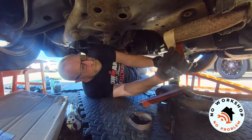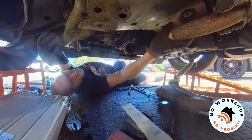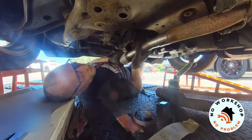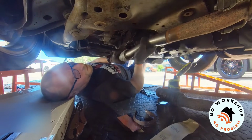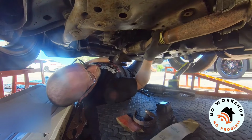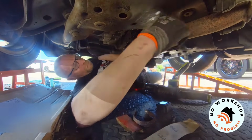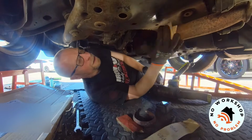Now I suppose at this point naively I thought it would be as simple as cleaning up the end of the old exhaust pipe and slipping the repair section over. Got to say, cleaning up that old pipe took longer than I expected, as you can see here through the various time lapses. The corrosion was well established, and the new part gave me a little bit of a challenge in that the expanded end that should just slip over that old pipe really wasn't expanded as much as it needed to be. And that resulted in me having to do a lot more sanding than I thought I would have to. As you can see here, I even at one point considered welding the old section back in if I needed to. But I slaved on with the P80, doing the best that I could to get all of the corrosion off the old pipe, to give the new pipe as much chance as possible of slipping cleanly over the end.